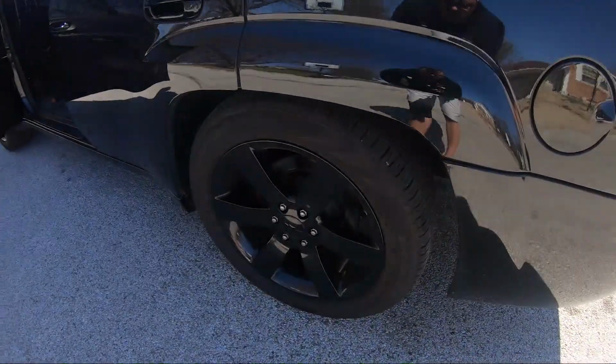So I'm gonna go ahead and fix that steering wheel position sensor, and fix an air line in the back that's leaking, causing these bags to lose air randomly, because the previous owner deleted the compressor because it had gone out, so he just turned it into a manual kind of thing. And then in addition with that, I'm doing rear shocks for the rear, to stiffen it up for launches, corners, stuff like that. But other than that, I'm gonna get at it, guys, because I don't have much time to lose.